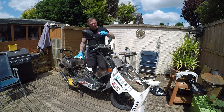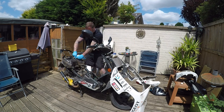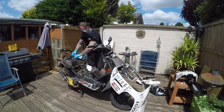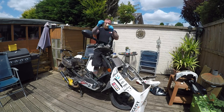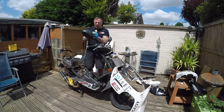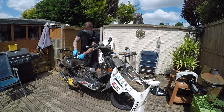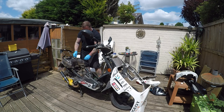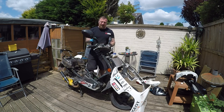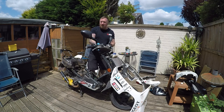The tank is half full of petrol, yet the gauge is only reading just under quarter. I'm going to unplug this — it just unplugs — and take it out. There's your fuel gauge — it just goes up and down. A bit of WD-40. I've mentioned this a lot of times — this little gauge is really, really simple, not rocket science to get in and out, but it really does help having it working properly.